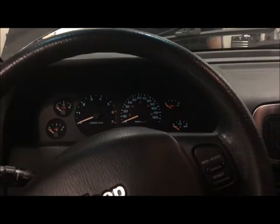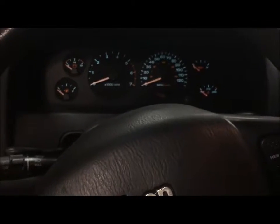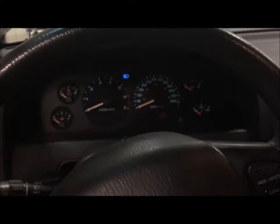Next we're going to check the interior lights, make sure the lights on the panel work. Check the radio — it's not working, so we'll have to note that and fix it. Then we're going to look at the dome lights — those are working. The side lights on the inside work. The high beam indicator light on the inside works but it's dimming everything else when you activate it, so we'll have to check the dash lights.